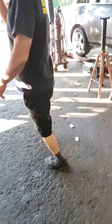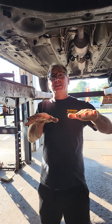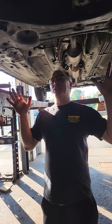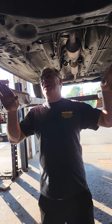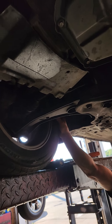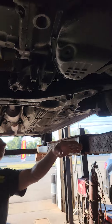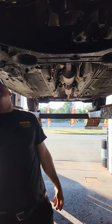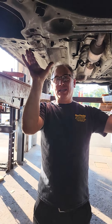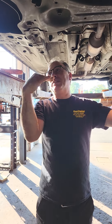We have a Nissan Versa and on a road test while you're driving and you hit the brake, you feel the car shimmy. That could come from the rear suspension or the front suspension, but I started in the front suspension. I did the rock test — roll the car back and forth. We don't see any movement in the control arms on either side, and the subframe is solidly mounted to the body. On the older ones they had rubber bushings where the subframe would move and make the chassis and the wheels move at different rates.